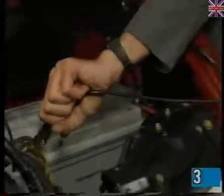To use the equipment, connect the red and black clamps to the battery, and the reference sender to the hole in the bell housing. The transducer should be fitted to number one injector pipe. Choose a straight section of pipe, at least 20 millimeters long, and make sure it's clean by polishing it with fine emery paper and a cloth. Fit the transducer as near to the pump as possible and connect the lead. Don't rotate or slide the transducer as this will damage the delicate sensor.